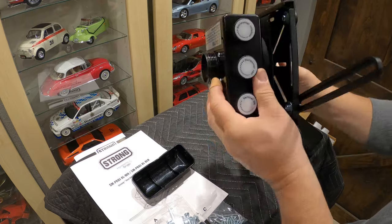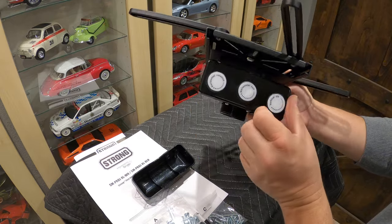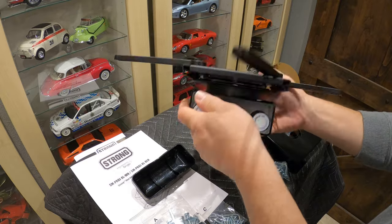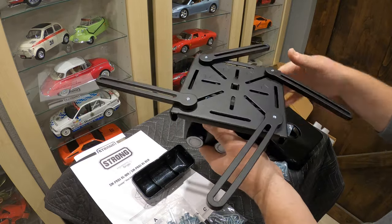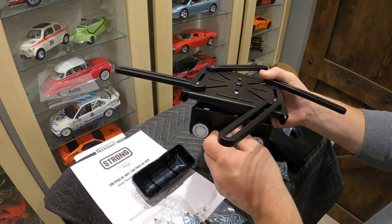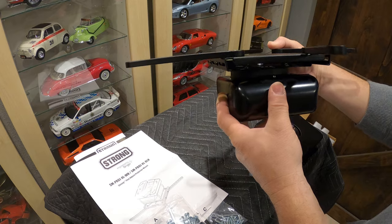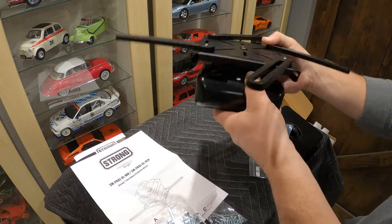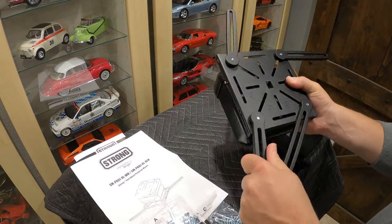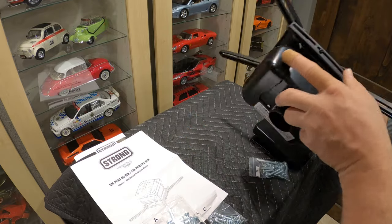And then here's your fine adjust. The reason most pros and DIY guys are buying this is because of this fine adjust. You've got a vertical tilt, you've got a roll, and then you've got a rotate. Your tilt is going to adjust the picture up and down on the screen. Your roll is going to keep it level. And then your rotation — which you shouldn't really have to use if you have it set up right and your measurements are correct — is to adjust the projector onto the screen. Get this thing level and set up first, and you shouldn't have to use the rotate too often. Then you can just do a little bit of shift on your projector.